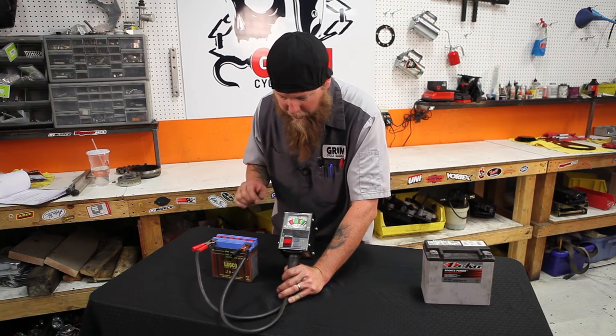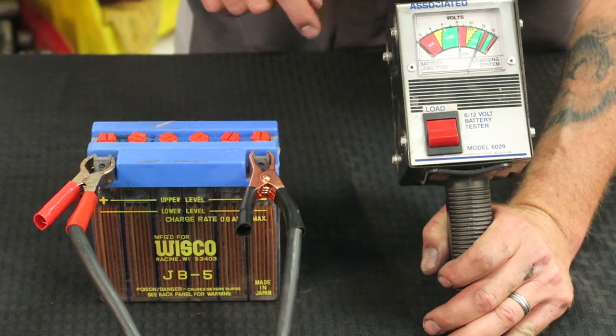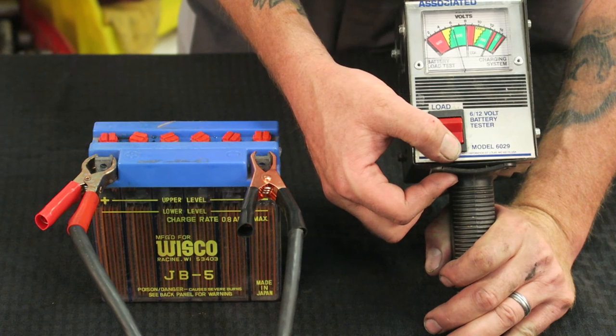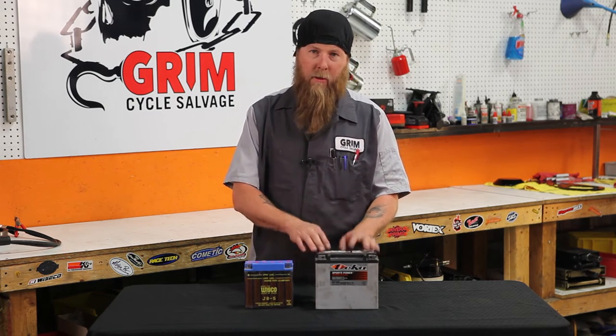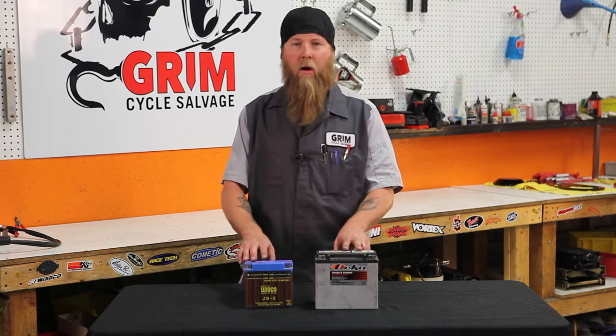This is just a regular lead acid filled battery — we filled it but did not put it on charge so you can see that in some cases you can measure battery voltage and it'll say 12 volts, but if you apply a load to it, it'll drop. We ran static tests on both batteries — one showed good voltage and held a load, this one had pretty good voltage but did not hold a load. If you come into that situation, don't assume your battery's bad. Throw the battery on a trickle charger for 24 hours, then run through those same tests again. If at that point it doesn't hold a load, you do in fact have a bad battery. Later on, I'm going to show you how to do a mock load test on your bike using your starter as a load tester.